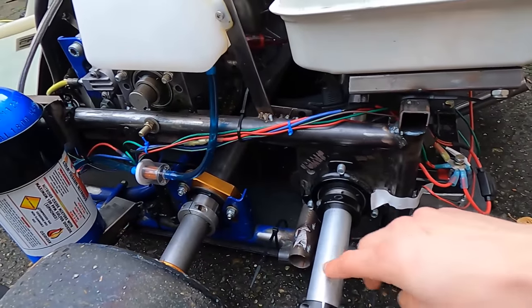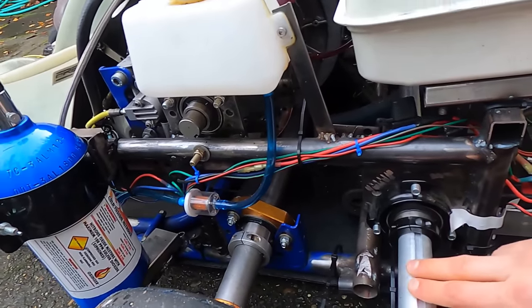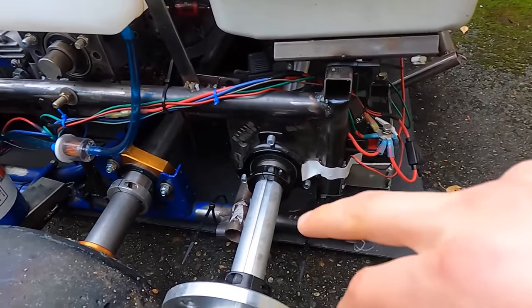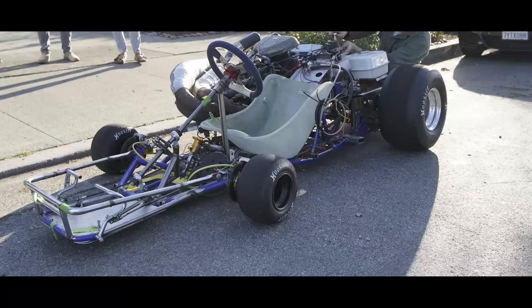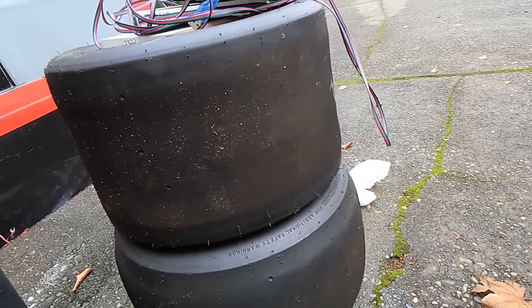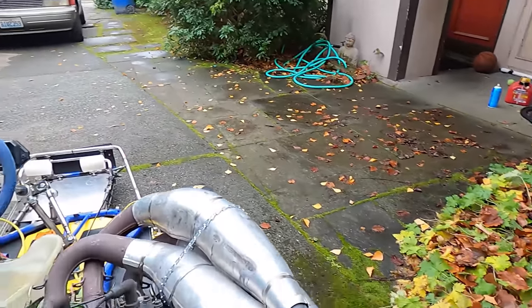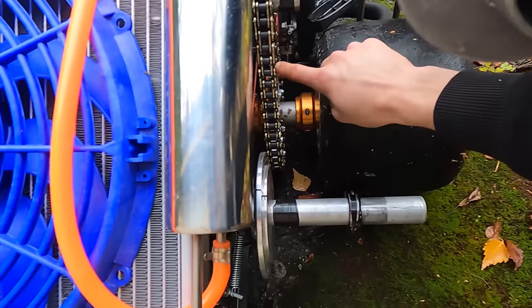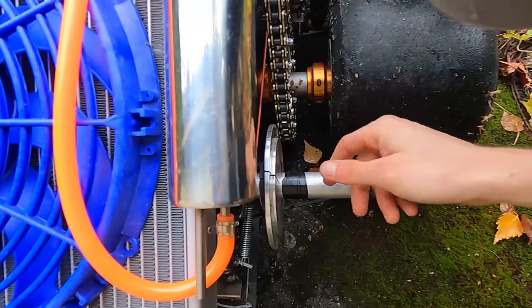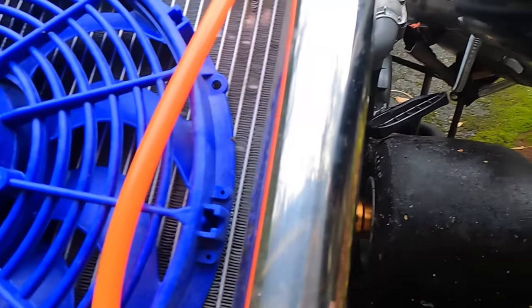As you can see, we got two axles. We got the standard go-kart axle right here. We also got an inch-and-a-quarter axle that I can run these junior drag tires on. Pretty easy to swap out, and these junior drag tires hook really well. All you got to do is take off this sprocket and chain, and then I have another sprocket and chain already measured up to go. Just swap in the master link, throw on the hubs for the junior dragster axles, and you're ready to drag.